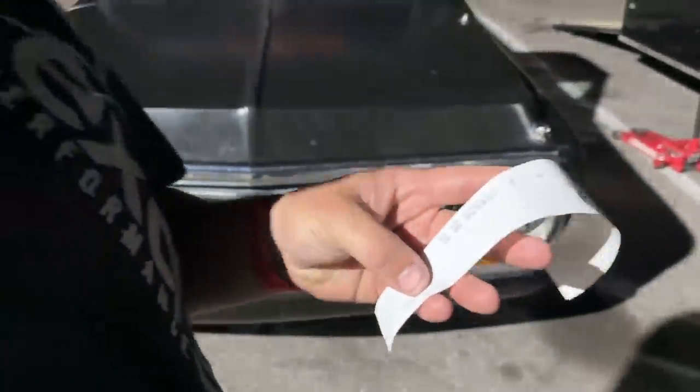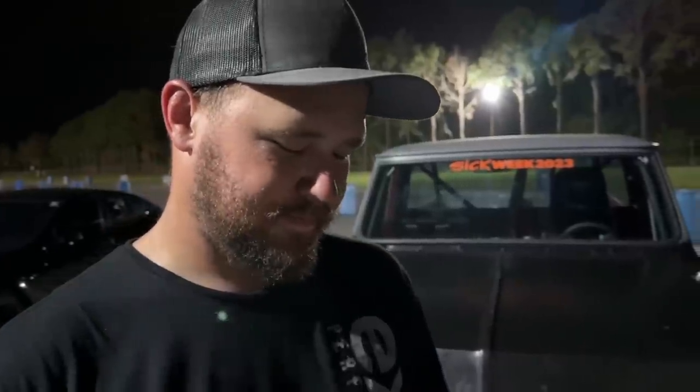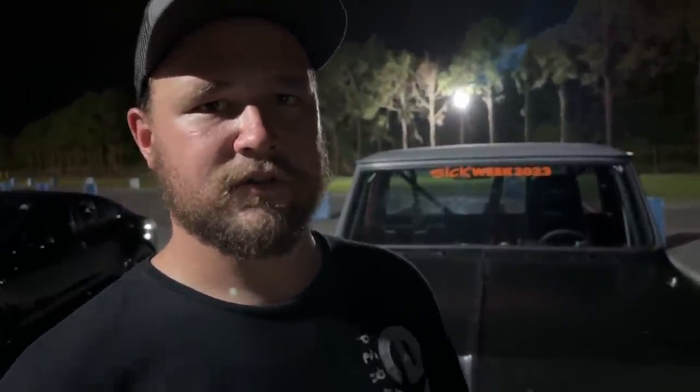But she's slipping. I saw you let out at the end there. Yeah, so the second I grabbed fourth gear, it started slipping. So I was talking to the transmission builder, and we're gonna data log the actual transmission controller this time, see if we can get some more data, see what it's doing. They're gonna go up again? Yeah, we're gonna go make another pass, see if we can get it to replicate that, and also leave harder, see if it'll take the leave.